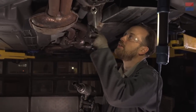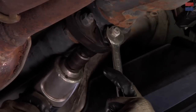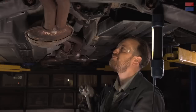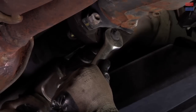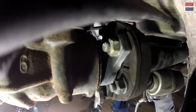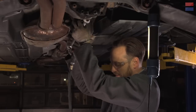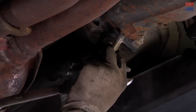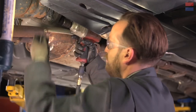I'm going to throw this box wrench on this side and the air wrench here. We've got the car in neutral so we can rotate this driveshaft around and make it easier to get to everything. Pay attention — these washers sit on this side of the bushing, so remember to put that kind of stuff back in when you reassemble.